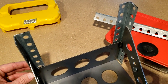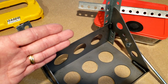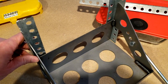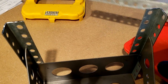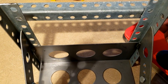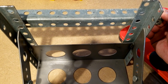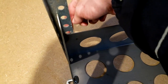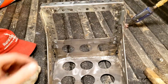I clamped the pieces in place and welded them up. For extra support, since the weight of the battery will be pulling on these arms, I took another piece of channel and welded it across — it bolts up from the bottom into the underside of the square tube frame. You don't have to weld this; you could drill holes and run bolts through instead. I used a grinder with a cutoff wheel, but a hacksaw would work too.